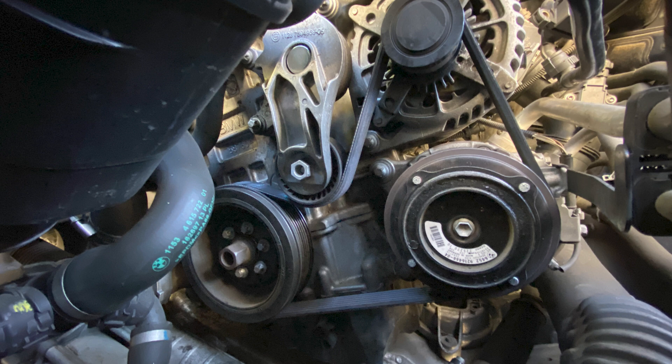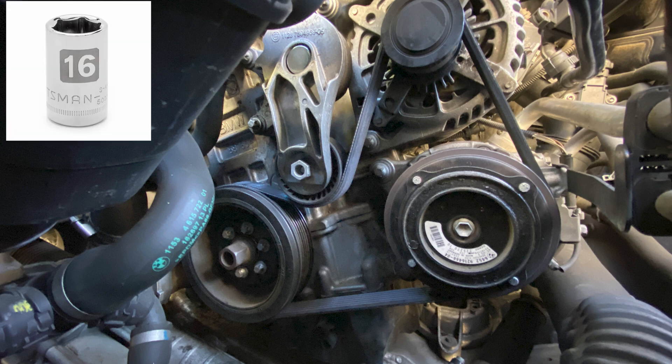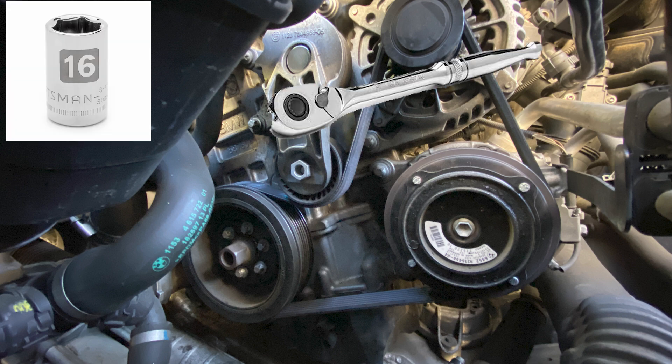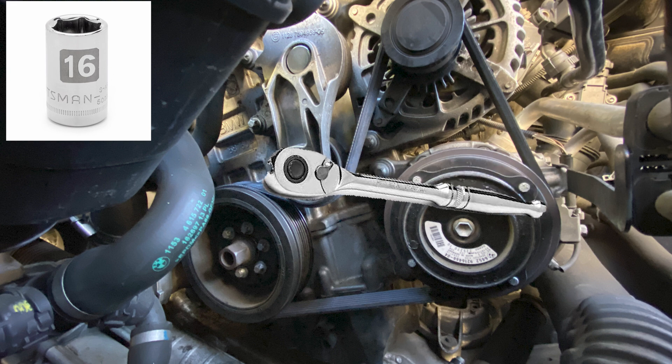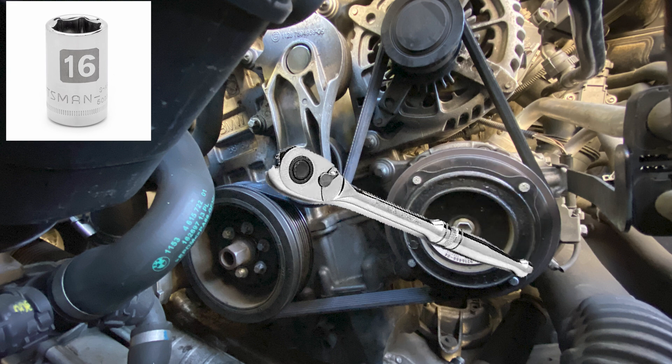This belt is very small. On the left side is the crankshaft, on the top is the tensioner, on the very top is your alternator, and on the right side is your AC compressor. We need to use a socket and drive to push down and clockwise on the nut on the front of the tensioner. That will reduce the tension on the entire belt system and allow you to slide everything off.